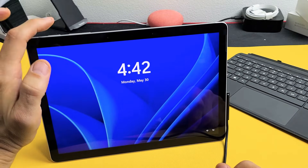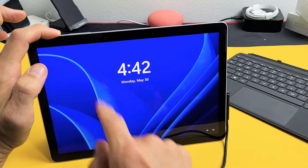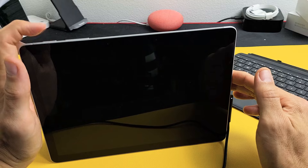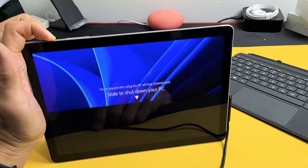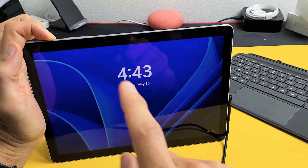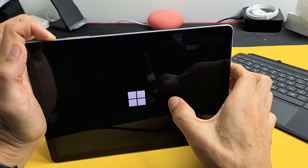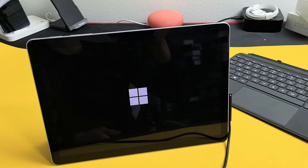From here, we're going to do the same thing with the power button. Press and hold that power button and do not let go until we see a Windows logo, then let go quickly. It's charging right now — pretend my screen is black here. Press and hold. Keep on holding that power button, ignore what's happening to the screen, just pretend it's a black screen. I'm just holding on to this power button waiting for that Windows logo to appear. As soon as it loads, let go of the power button quickly — Windows logo, there it is. Let go quickly and go ahead and let it boot up normally. Hopefully your screen is up and running now.